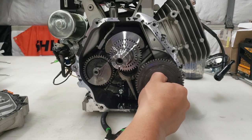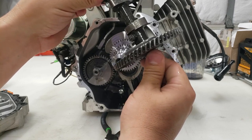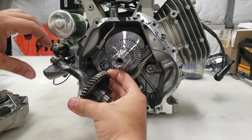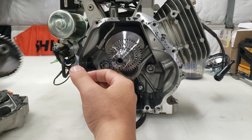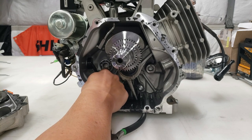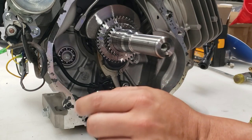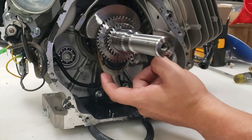Go ahead and pull the cam out — everything on the cam looks to be okay. Lifters are all right. Check the balance shaft — that surface seems to be okay. Governor's still intact and our balance shaft bearing seems to be okay. So yeah, it just looks like that bolt backed out, and that's all the noise I was hearing — this thing rattling around, and it probably ate up the bearing. Let's go ahead and get this rod and the piston out and take a look at it.